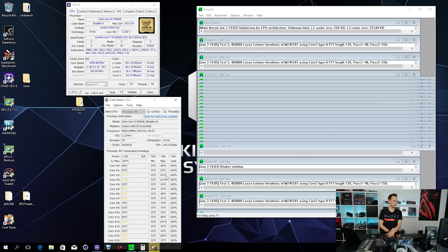The question is why there's such a massive temperature delta between the cores - we now have 22°C between the coldest and hottest core, which is a lot and something I did not expect from a soldered CPU. We learned from the 9900K that even a soldered CPU can be really hot, though in that case a thicker die also played a role. On the 9980XE, I think the chip thickness is exactly the same as before - the 7980XE was already thicker than the 8700K - so I'm not sure what the reason is for these insane temperatures.